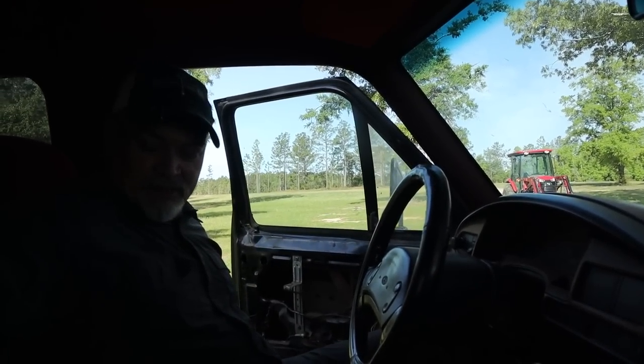Well there she is. The job took an hour. When I messed up by taking that retaining clip off, that probably added 10 to 15 minutes. So 30 to 45 minutes if you don't make that mistake. It's a pre-bled system from carparts.com — the best price I could find. You'd save fifty to sixty dollars buying one that's not pre-bled. All you need is a half-inch ratchet wrench, flat screwdriver, side cutters for zip ties, and a flashlight. Simple project.